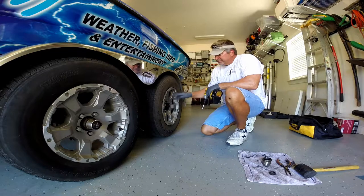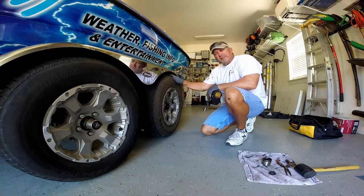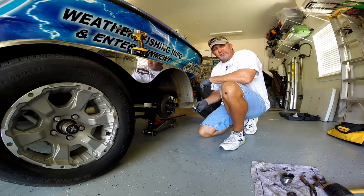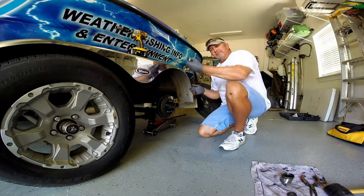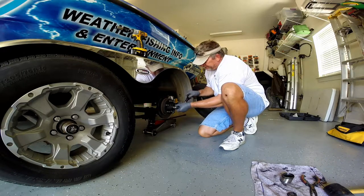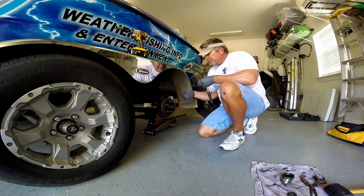When you're adjusting your bearing nut, you want to make sure that you release as much pressure as possible on the bearings, so I'm going to go ahead and remove the tire as well. Tolerance on this bearing nut is 18 to 20 inch pounds. I have my torque wrench here, I set it to 19 inch pounds right in between. It's a large nut, so you're going to need a large socket and adapters. And that's it — 19 inch pounds right in between.